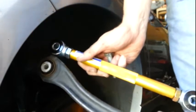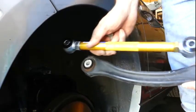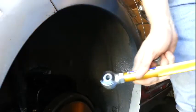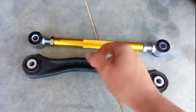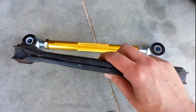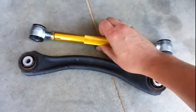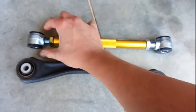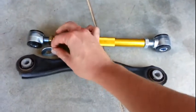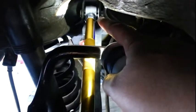The thing you want to do is line up the tops and bottoms of the holes, make sure they're at the same distance, and then put the new suspension arm back into place. The ends on the new suspension rods are not as wide at the ends as the originals — that could create a real problem when moving back and forth inside the mount at the back of the car. So I've added a fender washer in place there at the front of the vehicle to compensate for that difference.